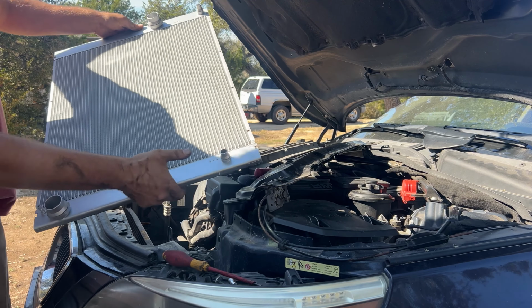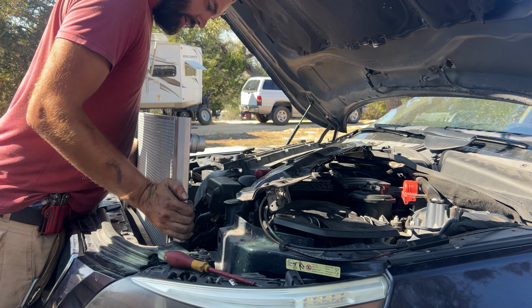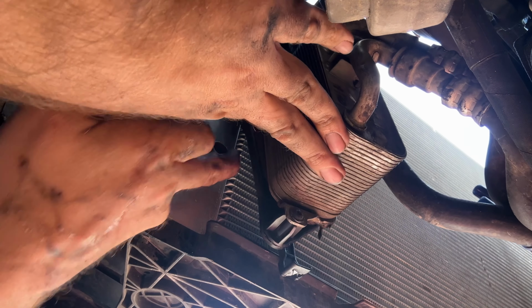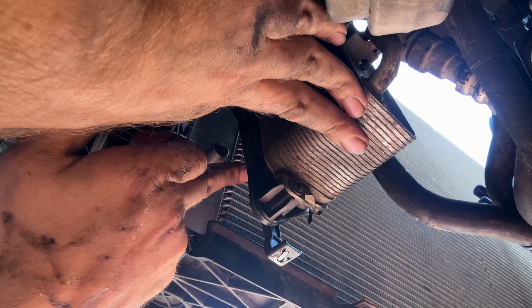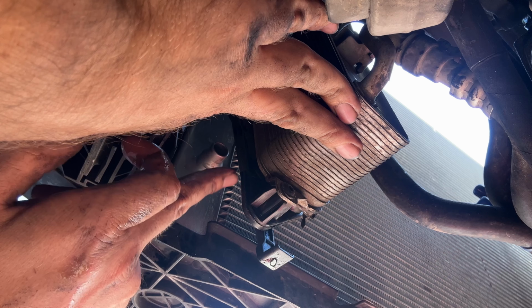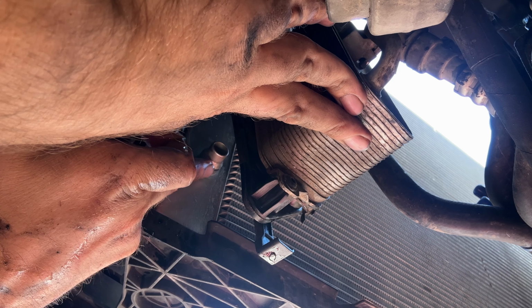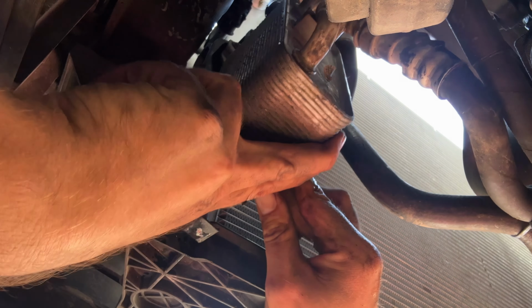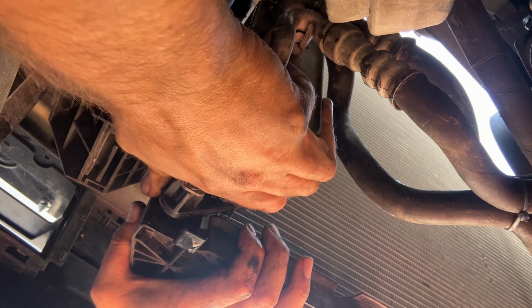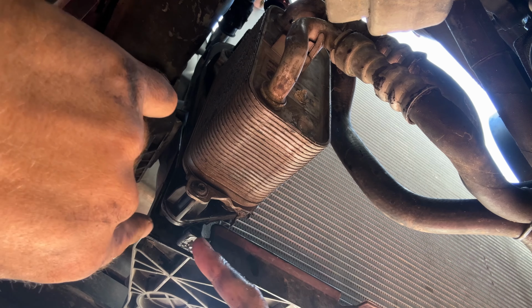Okay, we removed the caps that were plugging up the holes, so let's go ahead and then we just slide it on. It's really important to lubricate this because if you don't, the rubber O-ring inside here is gonna catch this dry spot, and it will be very, very annoying to get this on there. Well, it's because we gotta put some oil on this. There's a little hook, it catches that, and then you swing it over and press it in all the way, just like that, and then press it in, locking it. Again, without oiling that up, it will be the worst thing ever.